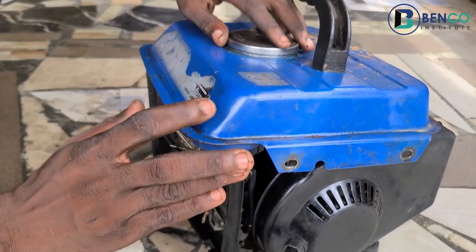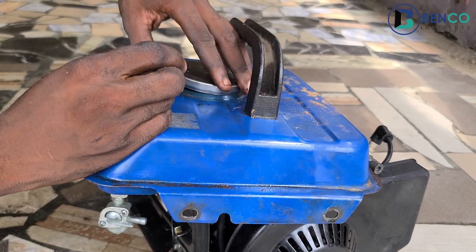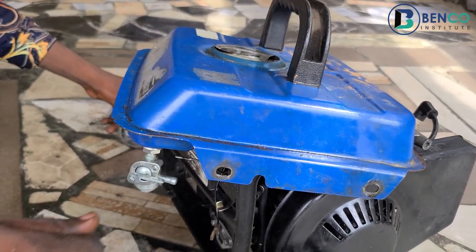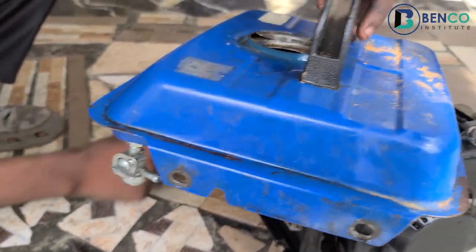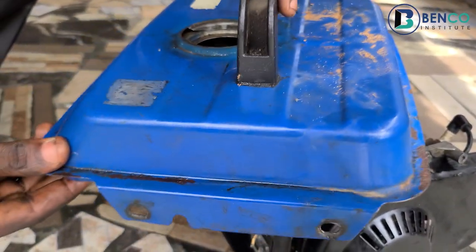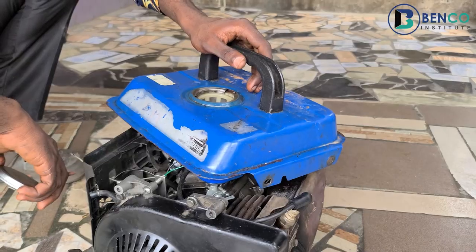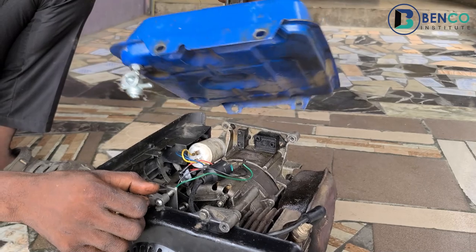Up next is to couple the tank, but before that I'll quickly wash the tank because I've confirmed it's dirty. When your tank is dirty it can transfer dirt to your carburetor, which in turn makes your carburetor overflow. I'll take off the filter, loosen the fuel tap, then shake and pour the contents into a fresh container where I can sieve the fuel and pour it back, or get fresh fuel. Okay, I've turned out the bad fuel in the tank and we've filled it with better fuel.